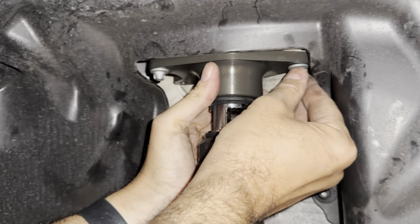We did go stiffer, quite a bit stiffer in the back end, because I'm not running aftermarket sway bars. Had I been running aftermarket sway bars, we might have had a little bit less there to even it up. But I prefer to have cars set up with stiffer springs rather than try to compensate with the stiffening of sway bars. So yep, Shockworks did a good job. I went through with them, told them what I was doing, what specs I run, what tires, what kind of alignment. I'll put the alignment specs up on the screen now as well, and you can check that out.